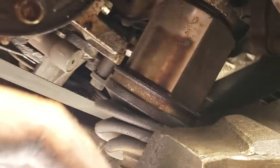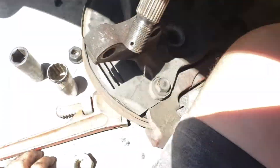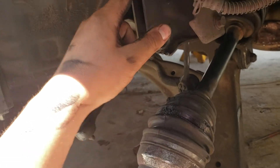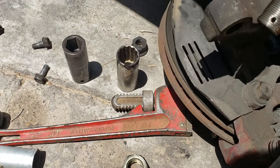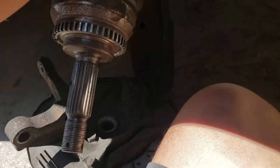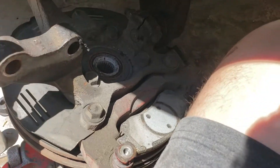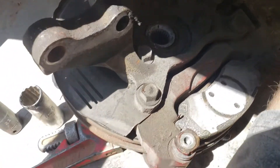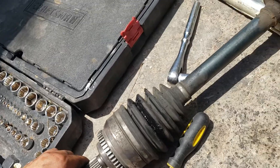When you put it back in, just repeat the steps. To recap the sizes: 14mm for the caliper, 17mm for the link, 21mm for the lug nuts, and 24mm for the strut. When reinstalling, hit it right here — but be careful not to damage anything — and put something there to protect it while you push it back in.